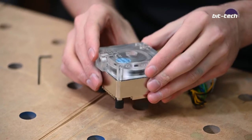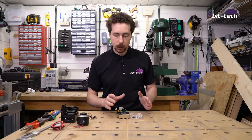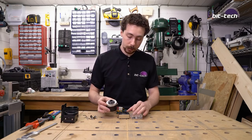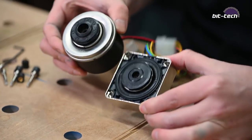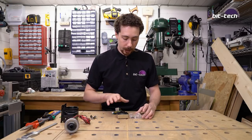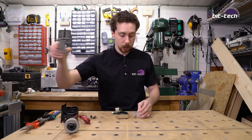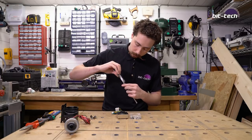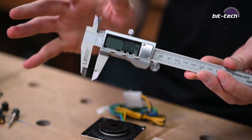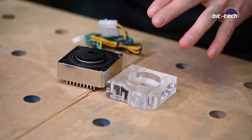The difference is they're significantly smaller. The impeller of a DDC is much much lower profile and this reflects on the fact that you can use a much shallower cut for the actual pump top itself. Measuring this one — that's only 7.8 millimeters, rounded up to 8 for safety. Much much shallower, so you've got an extra four millimeters to play with in comparison to the D5, which means you can use far thinner acrylic.